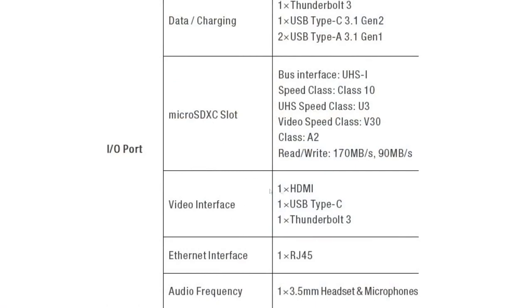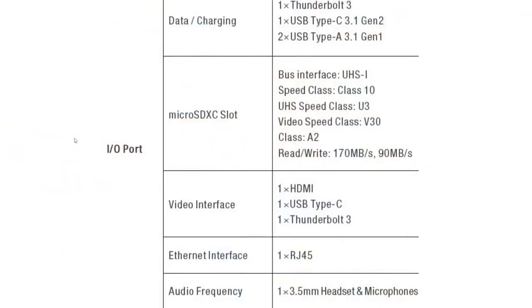HDMI is 2.0, so you can do 4K 60 with HDR support — that's accurate per GPD's page. Controller latency measured with a 240 fps high-speed camera is around 50 milliseconds from button press, near-optimal, and is as good over HDMI as it is on-device. The RJ45 Ethernet port is built in — no adapter necessary. I confirmed I saturate gigabit, getting 111 MB/s. Works perfectly. Convenient and awesome.